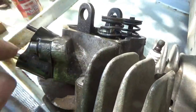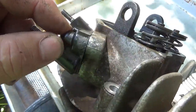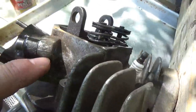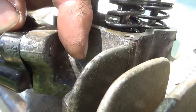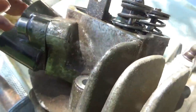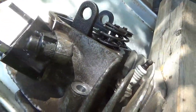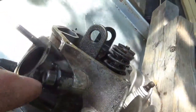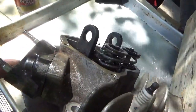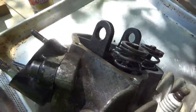I put the carburetor flange back on, and you can see I'm using 5mm Allen bolts, M6 1.0 pitch. So they both tightened up — they're not slipping. But I think I'm just going to go with a slightly longer bolt and back this up with a nut on the back side of it. It looks good; it looks like it's going to work out. I would put a paper gasket here if I were him also — actually, I'll probably cut one out and glue it on there for him so he just has to put the carb on.